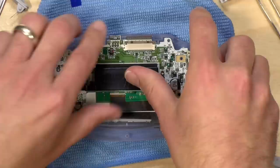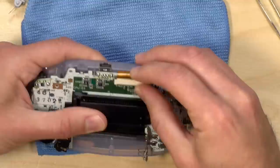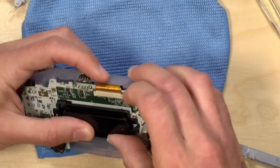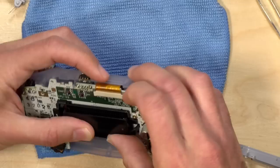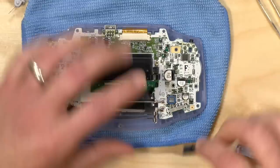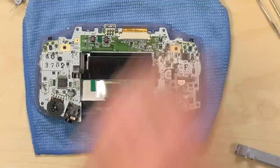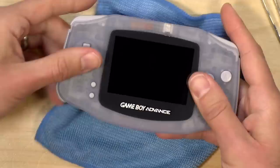I'm also moving that little sensor into the portion of plastic adjacent to where the Game Boy connector will go, because it needs to be in there for the sensor to work. Now we're going to lower the motherboard back down — the speaker helps align everything. We'll get the ribbon cable attached to the GBA's motherboard, connecting this new hardware to the old hardware. Slide it in and push down those two connectors we lifted earlier to lock it into place. Then attach the power button and secure the motherboard with screws. With any luck, this will boot up and give us a beautiful display.